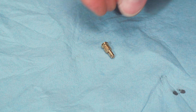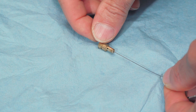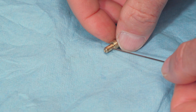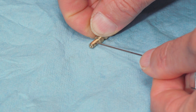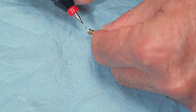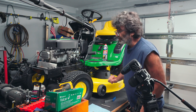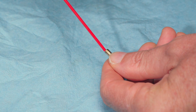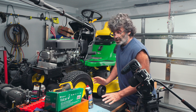Go ahead and use the rod — it's the smallest one usually — and just clean the end of that puppy out. This does not push all the way through, it stops in the middle. Clean that out. There are some little holes in the side, so let's clean them out too. That'll break everything loose. If you're working on a lawn mower and using the little pin drill bit set, go ahead and push it through just the same way. When I'm done with this, I like to take some parts cleaner — you'll want to be wearing safety glasses for this — and clean that puppy out. That should be cleaned up.